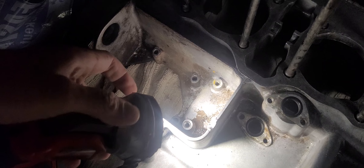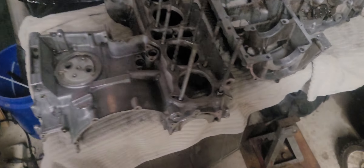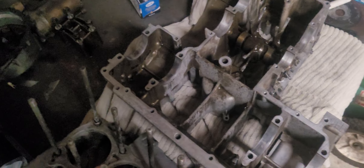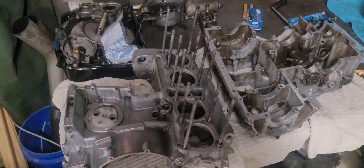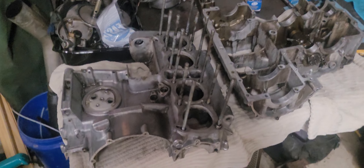One of the broken bolts was this starter bolt right here — I drilled it and tapped it, was able to repair those threads. It definitely took some time. The other one snapped on the case half, same deal: drilled it, tapped it, got it repaired. There's no rushing those. If you don't know what you're doing, find someone that does, because if you go in off-center you're going to do more damage and make it even harder to repair later.